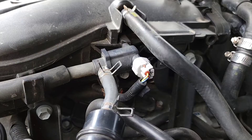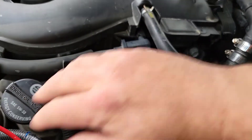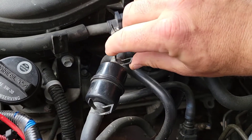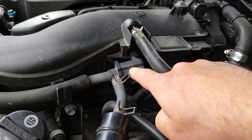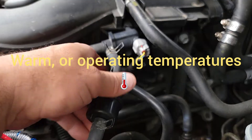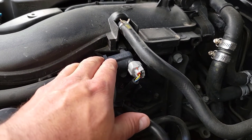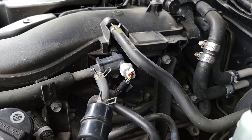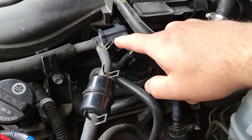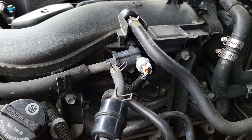If you have a Tacoma or a Toyota with the 4-liter, the purge valve is going to be right here alongside the oil cap. There's going to be a plug on it, a couple of vacuum hoses, and it will have the filter incorporated. You're going to want to find this valve, then take the vehicle for a ride and get it up to engine temperature. On this truck, the 4-liter, once the engine is warm and you're at idle, you'll hear this thing click, click, click — I'm going to show you that noise and what to do to verify it's working.